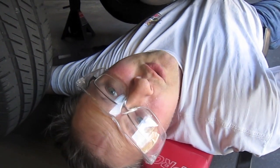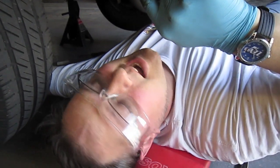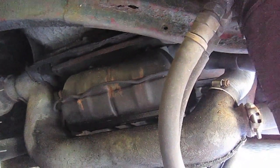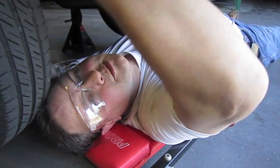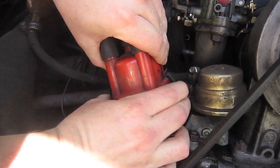Ready for pistons 3 and 4? Easy peasy — you've already seen it. The only difference is now we're on the driver's side. You pull off your valve cover, remove your rocker arm assembly, tighten down the heads, replace the rocker arm, and cycle the engine through. Notice where the rotor is. Piston 3 is the one towards the front of the car; piston 4 is at the back. That's really all there is to it. So you have adjusted all eight valves. Replace your valve cover, put the clip in place, pull the cover down to make sure she seats, and clip the distributor cap back on — give it a little twist to make sure that seats correctly.